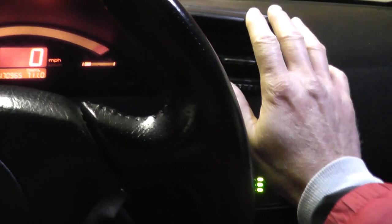The last thing: check your heat — it should be really nice and warm, no cold air whatsoever. And that's how you bleed the cooling system. Certainly keep an eye on things as the vehicle runs, make sure it does not overheat. Use the scan tool's data stream to keep an eye on the temperature and make sure those cooling fans turn on. I'll have a link in the description box below if you still have issues so you can pinpoint precisely what's going on. Thank you so much for watching.